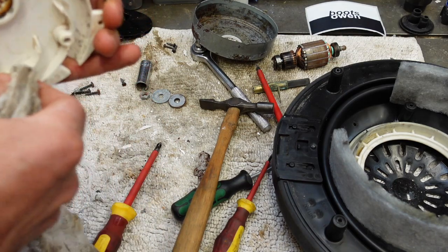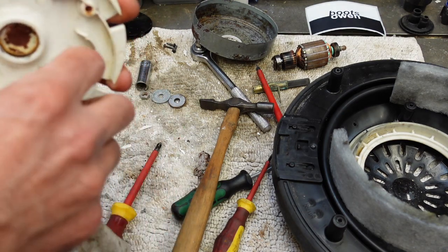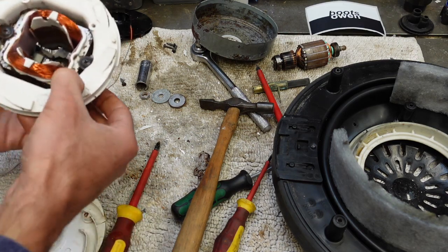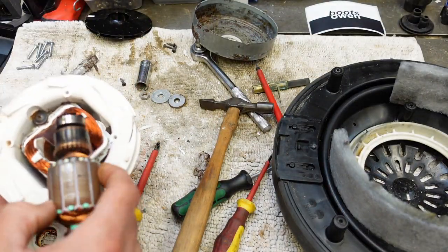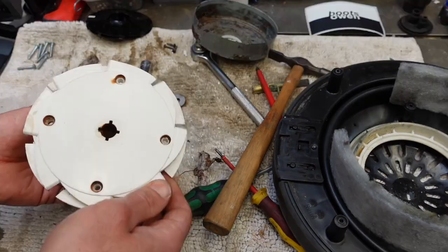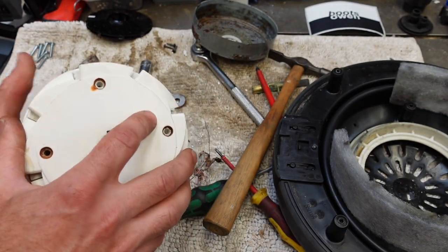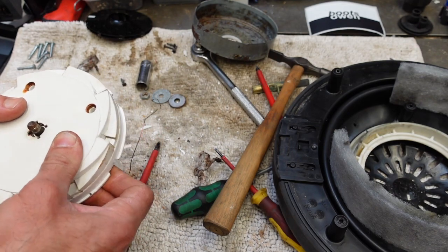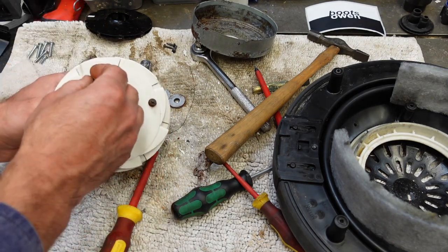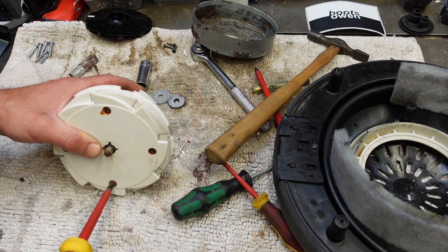Why would this have happened? Moisture followed by seizure, I think is the issue. It wouldn't take much for one of those bearings to be rusted up and for the shaft to get stuck. And once that's happened, you're not going to get it to turn. And once it doesn't turn, then it'll burn out or something like that. So the spring and the rotor go in there. And the bearing - let's give that a tap. I think that's home. This probably has an orientation - so it has some little studs, little dowels. Let's try lining it up that way. Four screws to go back in. Yeah, but like I say, I just enjoy this process - this is relaxation to me. So that holds the rotor in place. This is a universal motor - brushed commutator universal motor, so it should run on AC or DC.